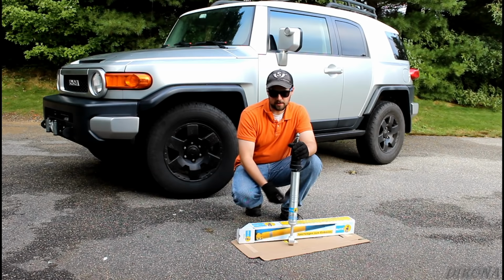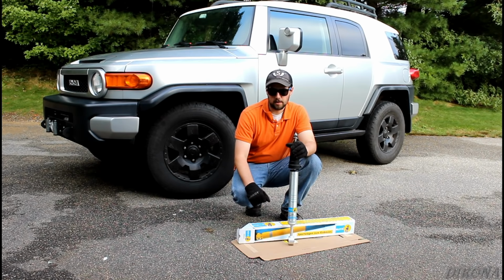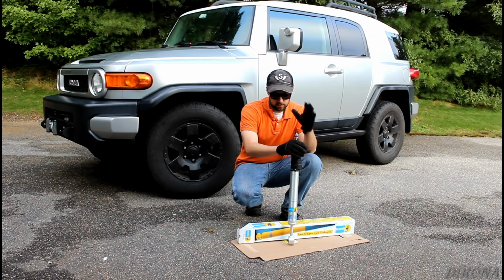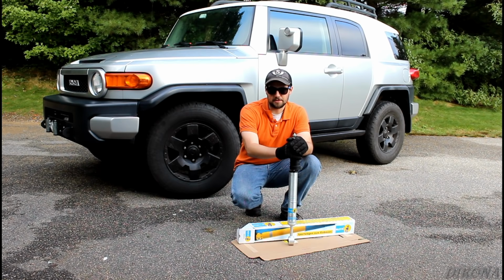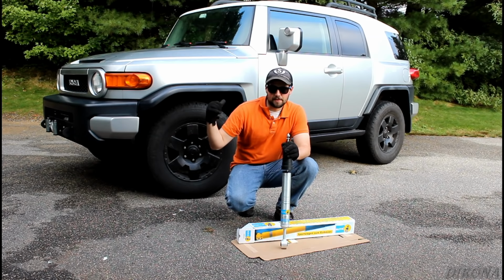So there are four different notches we can mount the spring on the shaft here, and based on which notch we put it in, it will raise or lower the vehicle. And I'm only doing the front. I had considered doing a full, regular lift kit, doing the front and rear together. However, I recently parked in a parking garage that this thing barely fit in as is, and I don't want to be limiting myself on where I can take this thing height-wise.